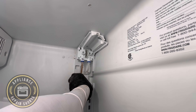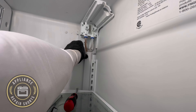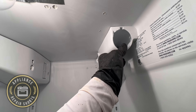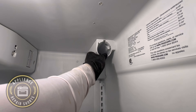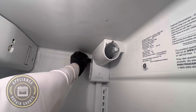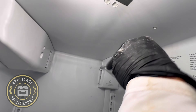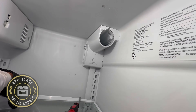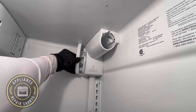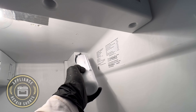I might include the installation video as part two. There's no other reason the unit would not be letting water in. The ice maker was also acting up — it was clumping up, which means the valve on the ice maker side was bad as well. The valve has been acting up previously. That pretty much covers it — thanks for watching, and I'll do a part two when I install the valve.